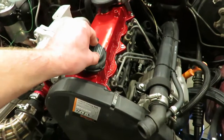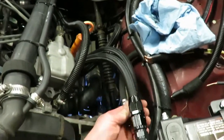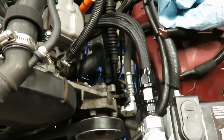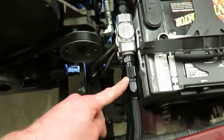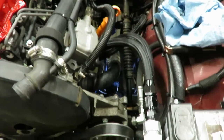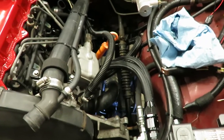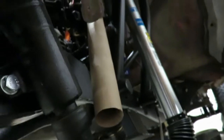I already changed the oil in the motor, so I'm going to pull this line off here - this one's coming out of the filter, it's the exit. I'll pull that line off, throw it in a jug, and crank it till I get oil here, just to see how long it's going to take. I was going to pull all these lines off or fill it with a funnel, but I'm going to see how long it'll take to crank and fill this system. I got that feed line coming out of the filter, ran it down, and stuck a little tube on it to direct the oil into an oil pan. I'm just going to crank it over until I get oil coming out of that line.